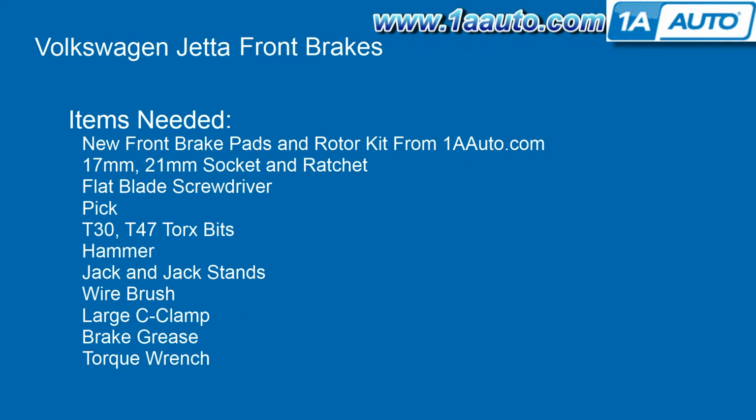And the items you'll need for this is a new front brake pad and rotor kit from 1AAuto.com, 17 and 21mm socket and ratchet, flat blade screwdriver, a pick, a T30 and T47 Torx bit, a hammer, jack and jack stands, wire brush, large C-clamp, brake grease, and a torque wrench.